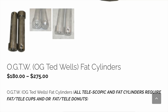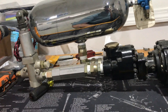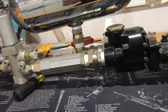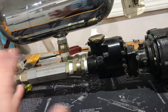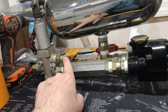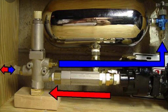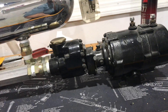Blackmagic Hydraulic sells the perfect cylinder for this — it's the OG Ted Wells cylinders. That has enough volume in it to lift up the car when you activate the Pesco 280. Fluid would return back from the equalizer into here, then a hard line would go to a slowdown. This is a 90-degree faucet style slowdown, and then the oil would go back into the tank. So that's how this works.